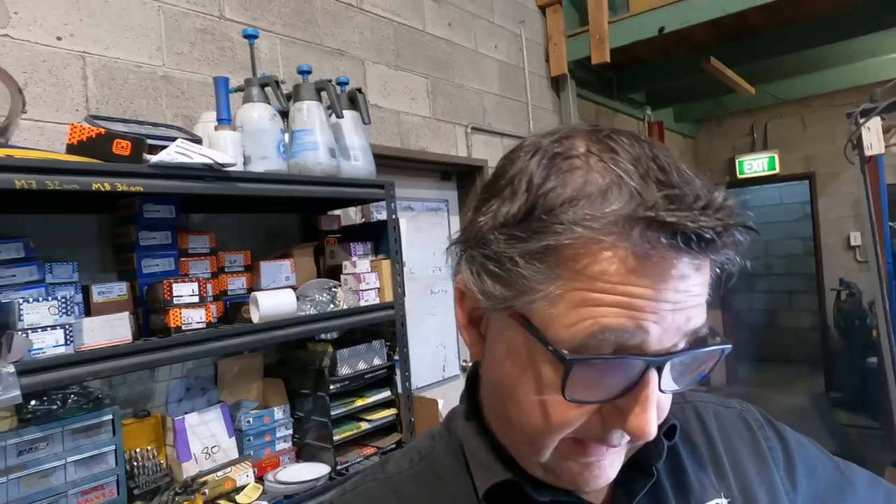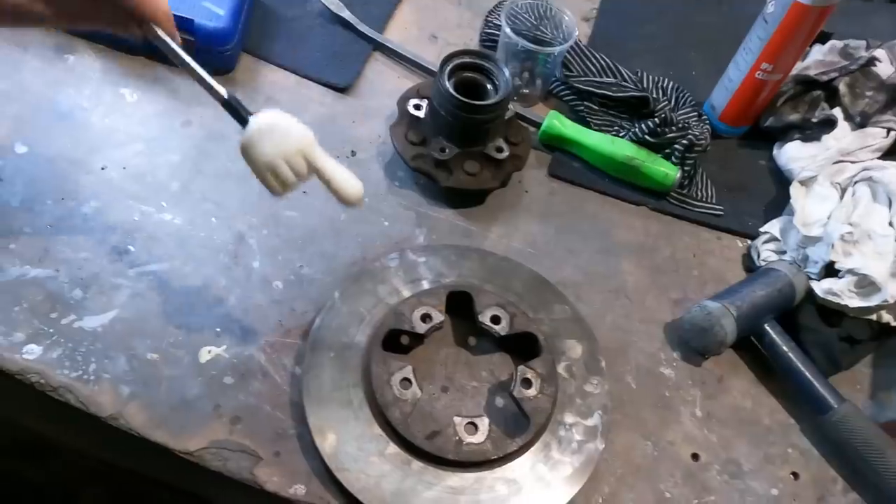Could be a couple of things. The guy that had it before me did a bit of work on the brakes - he complained a fair bit about how much money he spent on that. But it's got all new pads in it, everything's sort of new. The master cylinder looks really good, new brake pads, and the fluid's nice and clean. You might still give it a bit of a bleed. The problem, as far as I can see, is the rotors.